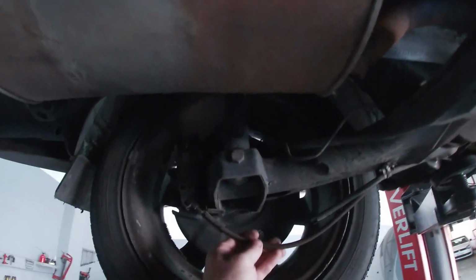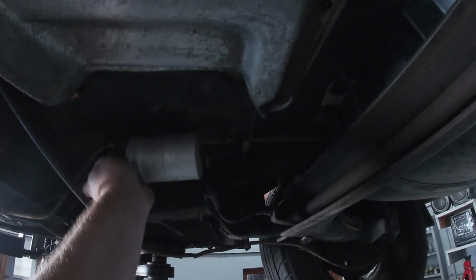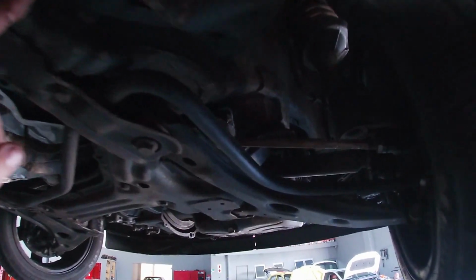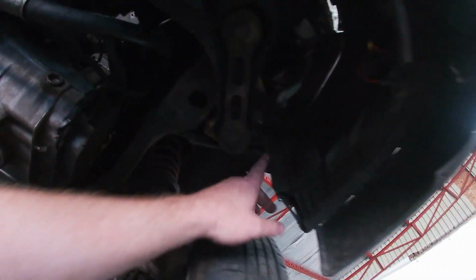And then I'm looking at the back, the handbrake cables, that's why the handbrake's not working. They're completely shoelaced. You can check this one as well, completely shoelaced. And it's missing the housing for the fuel filter. And underneath, it doesn't look too bad. I can see it's been worked on a little bit here. Most of this is just dents, we can have all this knocked out. The main part looks okay. Over here the fender liners are all missing. All these pieces are supposed to be a cover in here. Wires hanging loose here, they've put aftermarket globes.